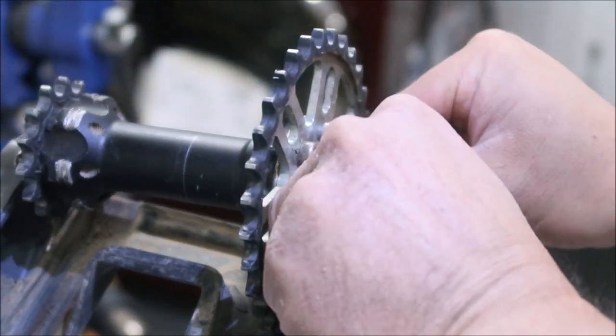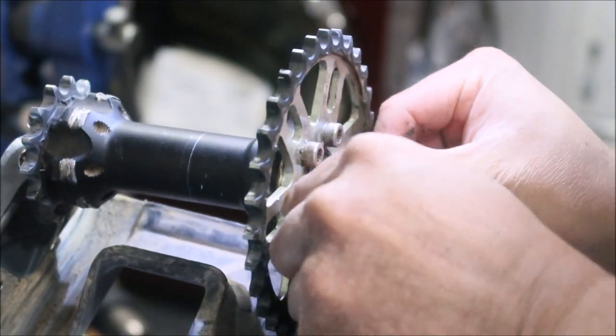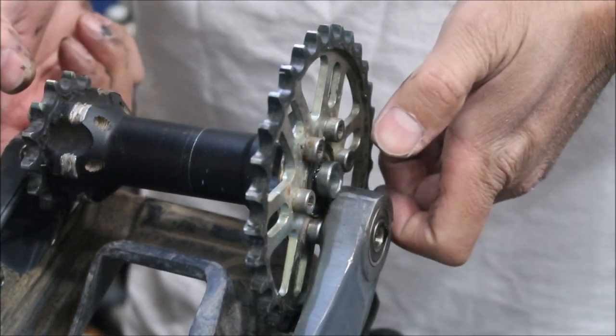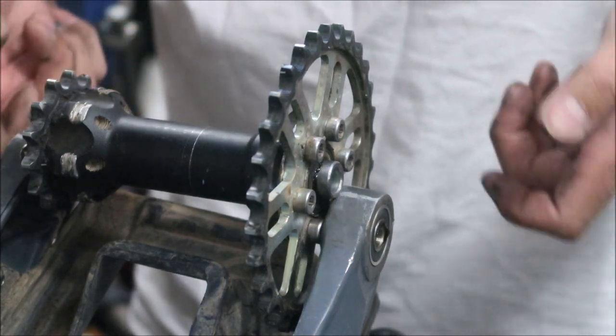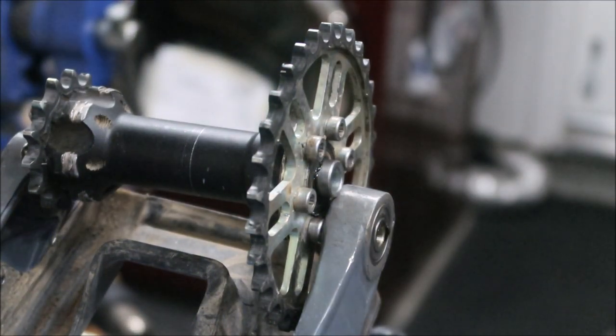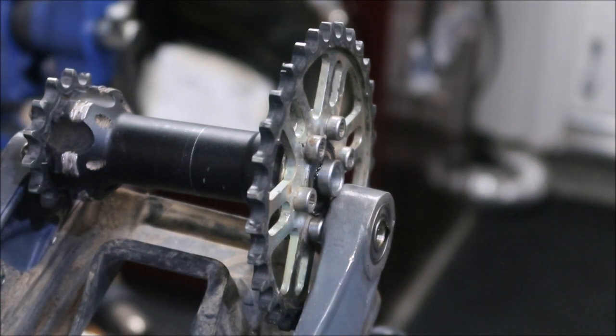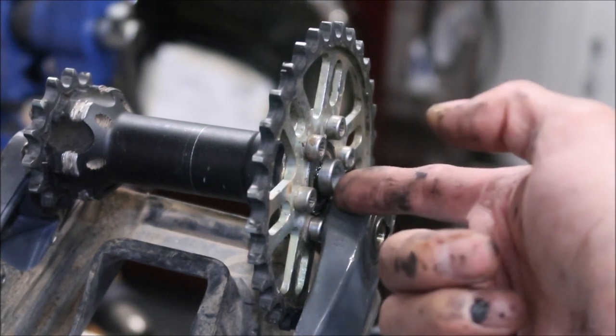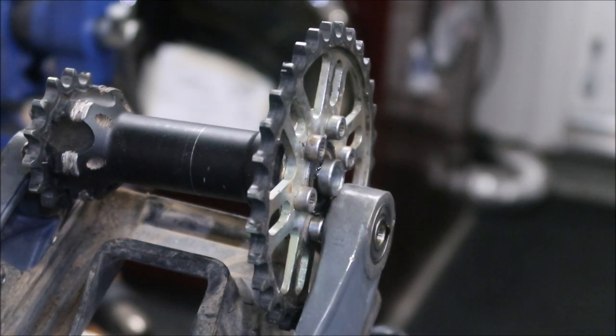The other side is already seated within the swingarm — it should just fit in there perfectly — but it doesn't. If I push the spacer flat it doesn't fit; it's about a millimeter off. I could probably bend the swingarm out a little, but we've reinforced it so much it won't bend anymore — it's super stiff, stronger than before. So what we're going to do is grind the spacers a little bit at a time until the jackshaft just slips in there.